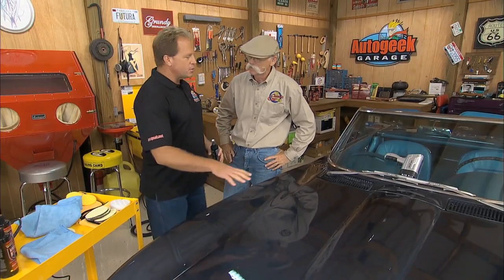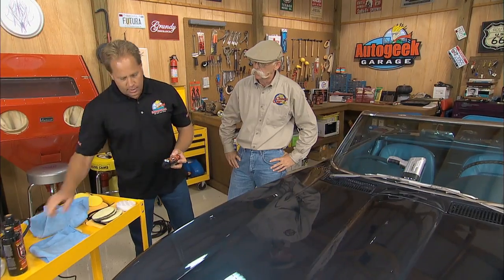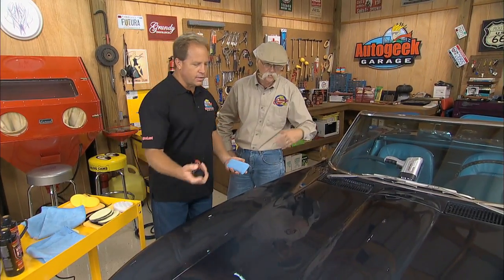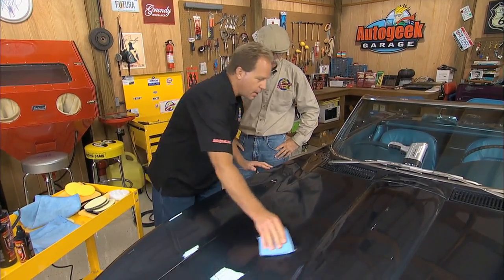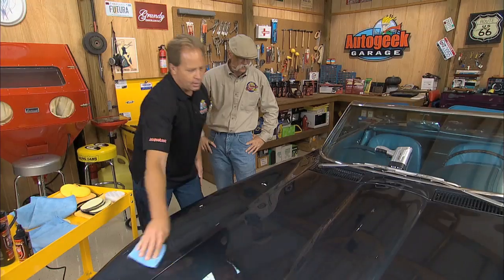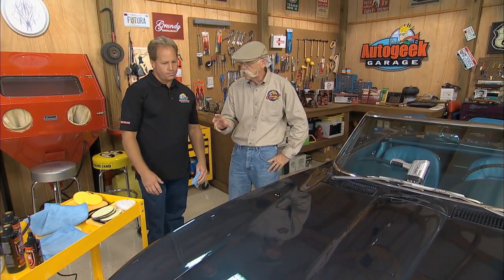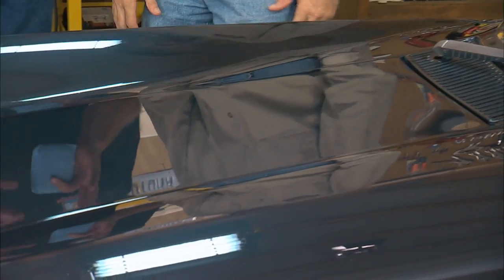Any time you polish the surface in that area, you take the wax off, so you want to put some protection back on. This is the Wolfgang Deep Gloss Liquid Seal. It's a pretty amazing product because, unlike a lot of waxes where you put it on and then have to wipe it off, you basically just put one or two little mists over the entire panel, take a microfiber applicator cloth, and gently spread it out — and you're done. You wipe it on and walk away. It chemically bonds to the paint and provides maximum UV protection, using UV inhibitors similar to what the paint has in it. So that's not just a detailing spray — that's a pure polymer coating. No cleaners, no fillers, no abrasives, nothing but pure protection.